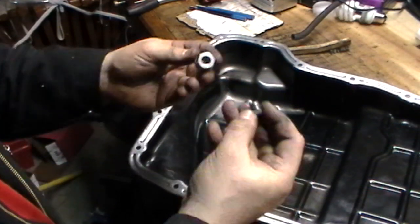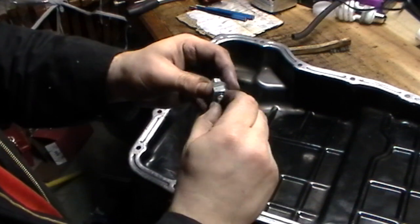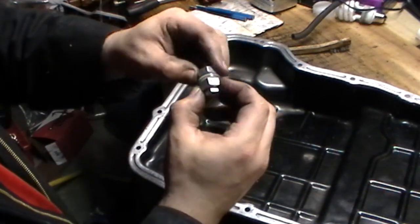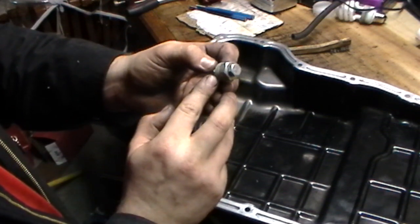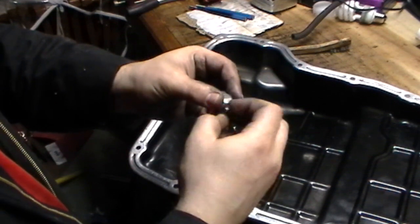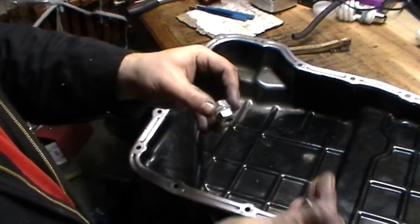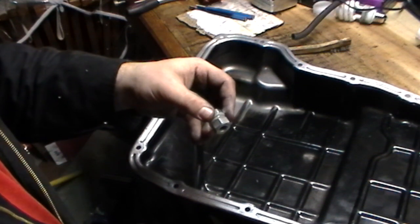The drain plug itself comes with a smaller plug that has a little rubber o-ring on it, and that is basically what your drain plug is. This part right here stays on the vehicle — you don't remove it or twist it. When you want to drain the transmission fluid you just twist this smaller plug out and all the transmission fluid will come out. It's a lot less messy than dropping the pan and trying to do a balancing act.